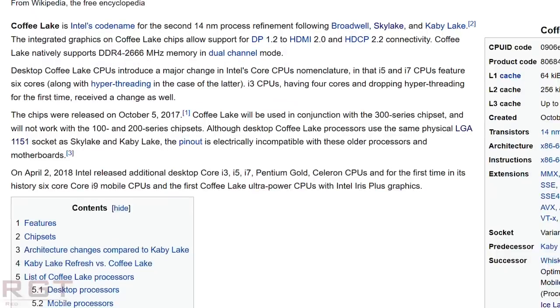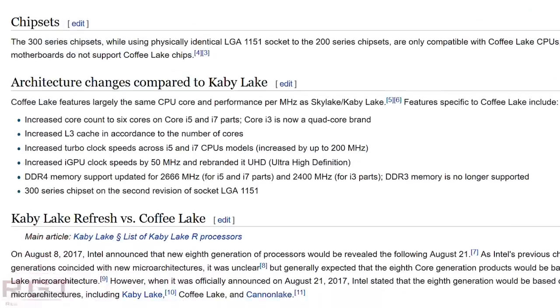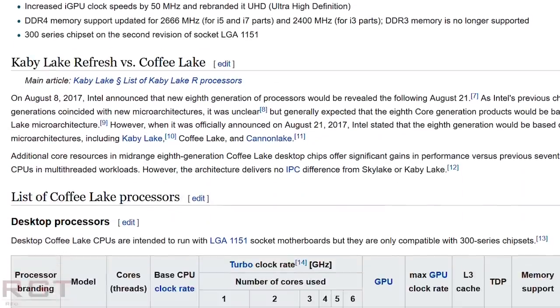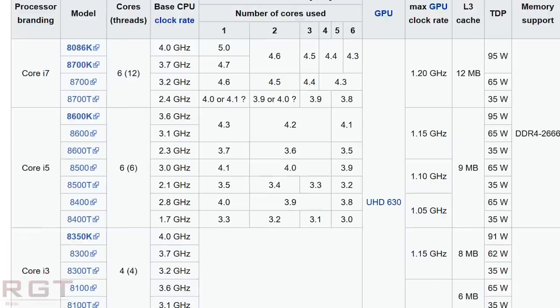That's not to say Intel don't release overclockable processors, but they are the K-series. I don't necessarily mind paying extra for the K-series. You can do a small base clock adjustment, but it's pretty much negligible — you get maybe a hundred or a couple hundred megahertz at best. So the main way to overclock your processor right now is using the multiplier with a K-series. This brings me back to the fact that those processors are not soldered, which makes me a smidgen bitter because I'm paying more cash just to be able to overclock.